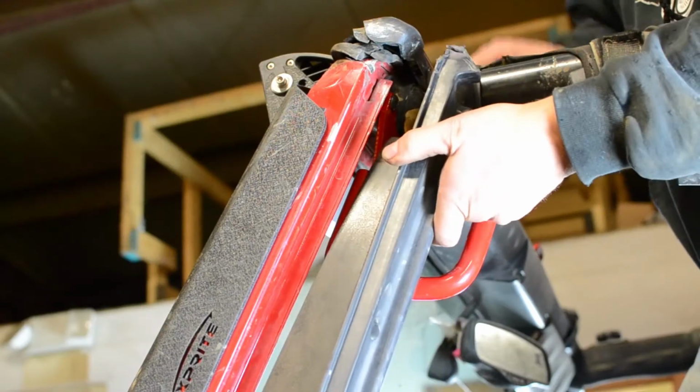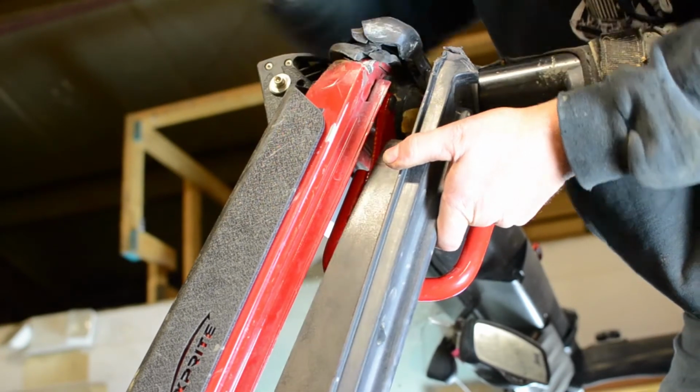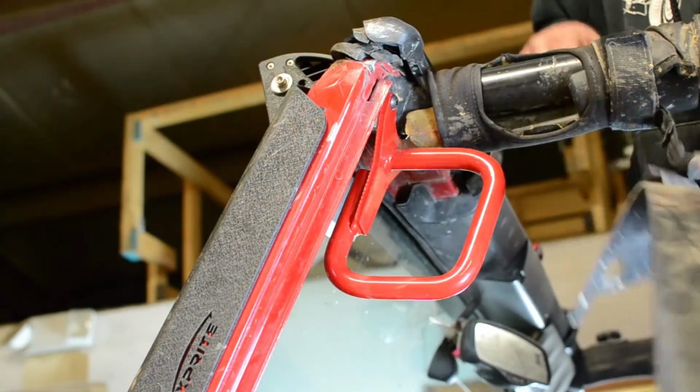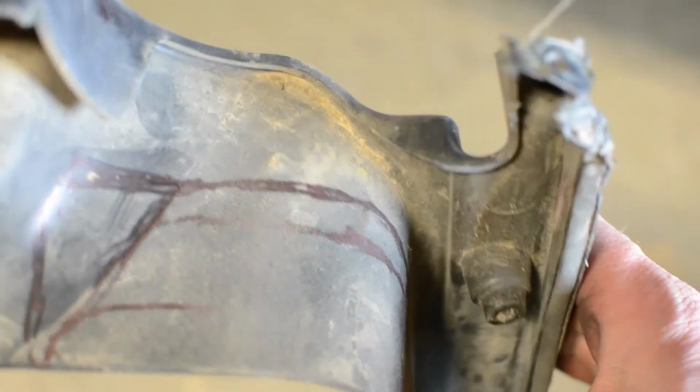You'll need to modify your A-pillar trim if you have an '03 to '06 Wrangler. Hold your trim in place and mark your interference points, and be conservative. You can always cut off more. Here is what we started with.